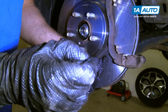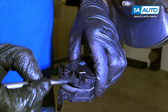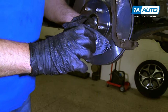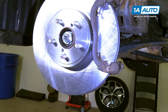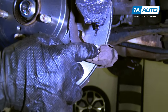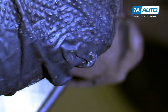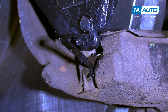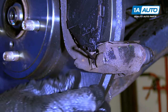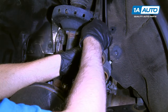We're going to take a little bit of brake grease and put it on the ends of these brake pads — on this side, this side, and the same on the other sides. Do not get the grease on the pad friction material. We'll start with the outside pad — this little tab is going to ride right along here, push it right there, and it slides in. That pushes on the outside. I'll take our bungee cord off the caliper and set it aside.